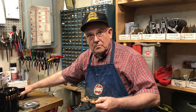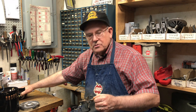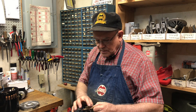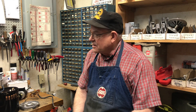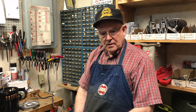That start switch has to open when the motor is in run mode. So if you have a shorted start switch, or the motor doesn't get up to speed, it's going to keep pumping electricity into that fine winding and you will burn it up. That's an expensive repair — four hundred dollars at least, plus tax and shipping.